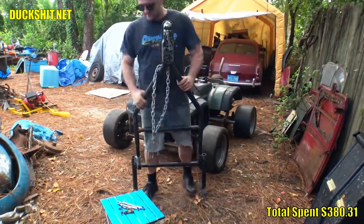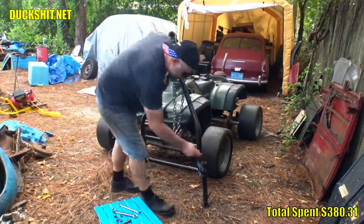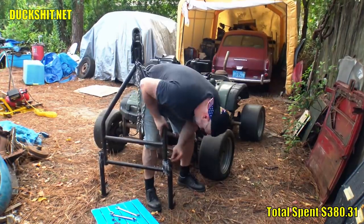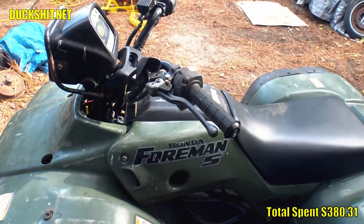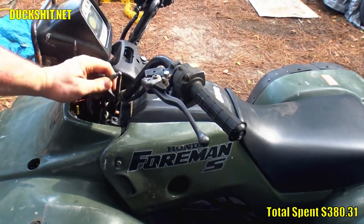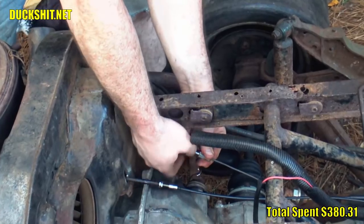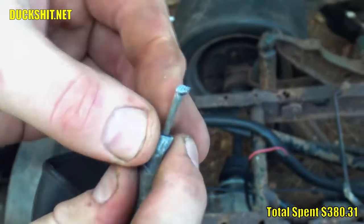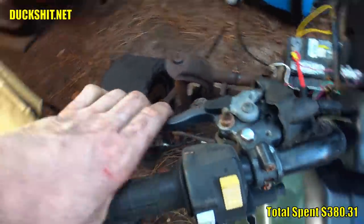All that matters not — I whipped out my tow bar because I was preparing to pull this thing to a local parking lot for a proper test ride video, when I thought it wouldn't hurt if I just took a quick test ride around the block before I left. Off camera, I went to take this thing out and I didn't even make it out of the yard. That's when the clutch cable snapped. I was rather pissed off at that moment as I had promised you guys a proper test ride, but that can't happen now. Evaluating the cable, I would have expected it to have pulled out of the custom end I put on the transmission side, but not so. Instead, on the stock Honda Foreman rear brake cable that was being used here, the top side end pulled off the cable and right out of the brake handle. With how difficult the clutch was to operate anyway, I already had plans for it, so I decided it was time to commit to phase two of this project and reveal the next plan.